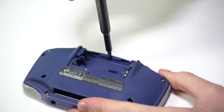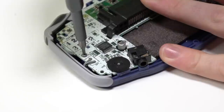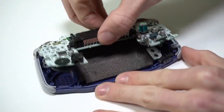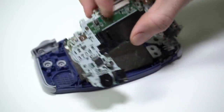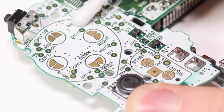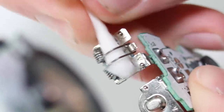Remember to remove the Phillips screw underneath the battery bay. Lift up the back of the shell and remove the two Phillips screws attached to the motherboard. Lift up the locks holding down the ribbon cable and gently lift out the board. You should take this opportunity to give all of the contacts on the motherboard a clean with some isopropyl alcohol and cotton buds. I also find an ultrasonic toothbrush to be very useful.